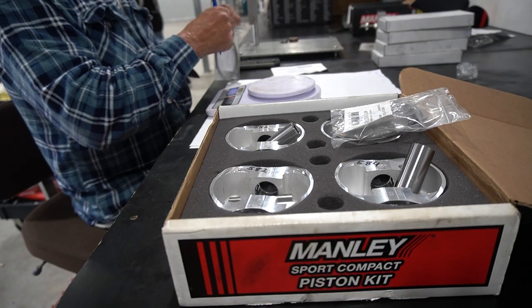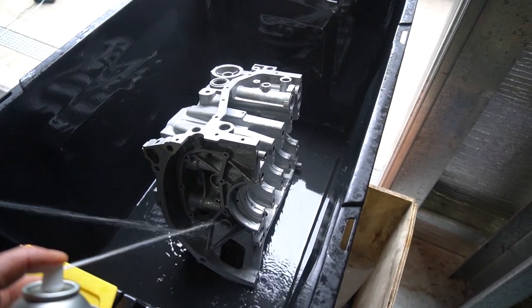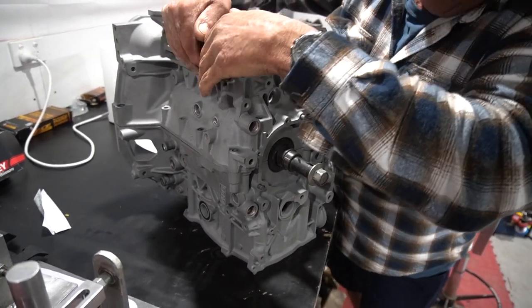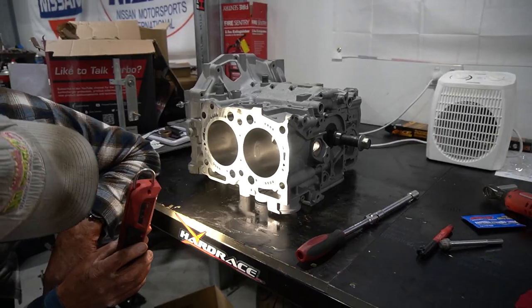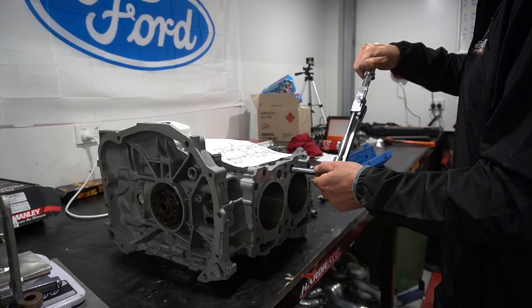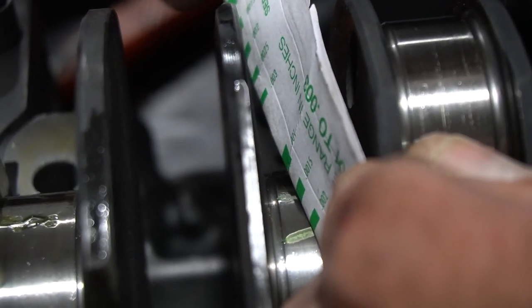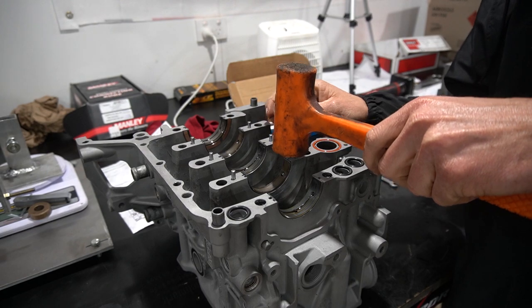We now spray the block down with what seems like 45 liters of degreaser, and it's ready for its first assembly. The first job is to confirm our bearing clearances on the main journal bearings using the plastigauge method — placing a thin strip of material onto the crank and then torquing the crankcase halves down to the required torque. It's important to note that some crankcase bolts seal against the water galleries in the block, so you have to make sure you get the correct bolts in the correct location; the ARP instructions make this super simple. Once the block is torqued down, we remove it all in reverse order, carefully remove the crank, and measure how much the bearing has squished the plastigauge against the scale on the side. With main bearings now within acceptable tolerances, we prep the block for final assembly — including all brand new O-rings and inserting the crankcase dowels.